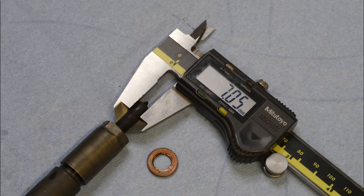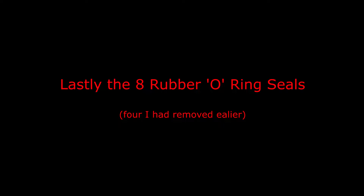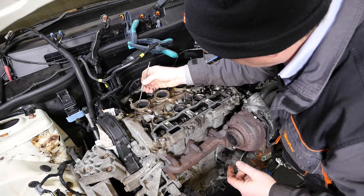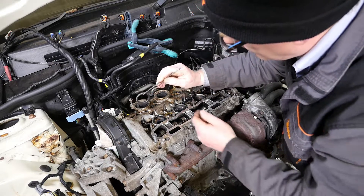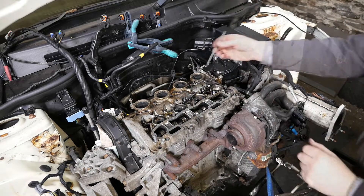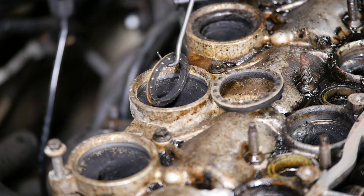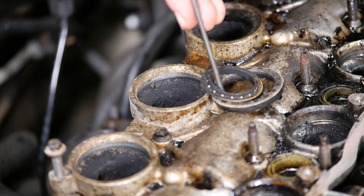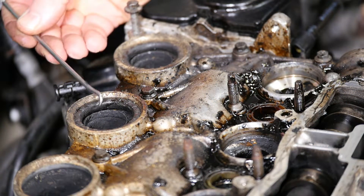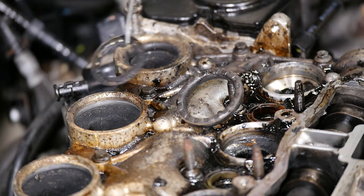Here's the measurements: the tip of the injector is about seven millimeters and the washers are about 15 millimeters in diameter. Lastly the eight rubber O-ring seals - I've already removed four of them. They're quite a soft rubber and I think that's like a retention disc to hold them on the actual inlet manifold. I presume these are normally on the inlet manifold and then pushed in - logically these would be replaced as well when rebuilding the engine.